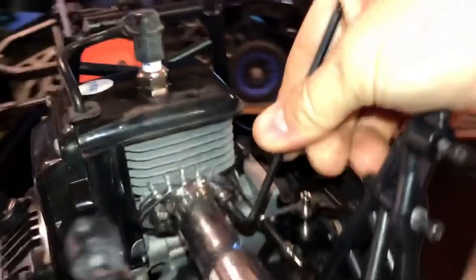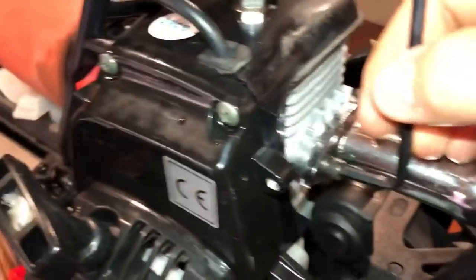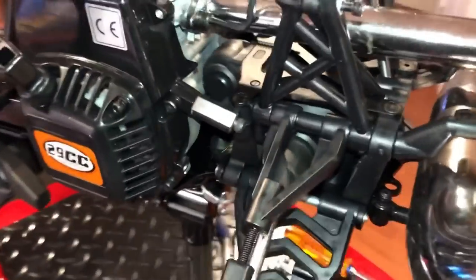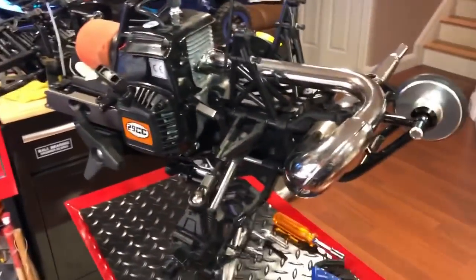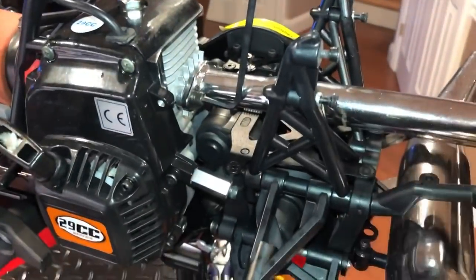Once they're broken loose, then you can get your tool in there and quicken up the job. So, oh, these were loose. All right, which is expected, this is a brand new engine. I did the heat cycles, I broke in the engine. Obviously, stuff's gonna get loose, right? If I would've kept running it, eventually these bolts could've possibly backed off.